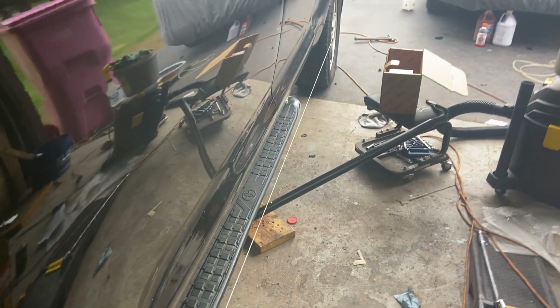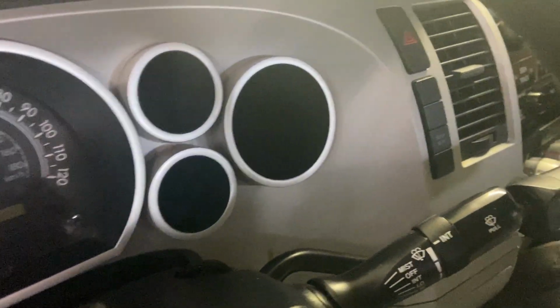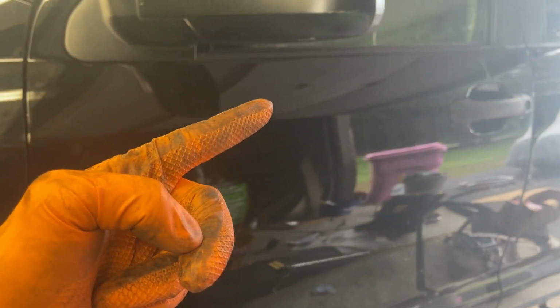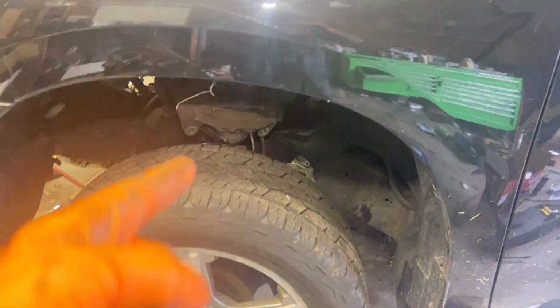So this was just a simple way for me to make sure that my wheels are pointed in the straight ahead position. I did mark everything, but I did so with white paint, and this project started a week ago, so as you could imagine, it's been through some hard moments. Anyway, I used the top of the steering wheel, which was perfect when the truck was going straight down the road, as a guide for inside the vehicle, and everything kind of fell together. So I will obviously find out really quickly if I'm wrong. And I will have to look and see if the steering angle sensor for this vehicle is in the clock spring. If it is, I can make it up in the steering wheel. If it's not, I get to scoot my butt back underneath the truck.